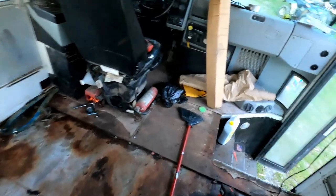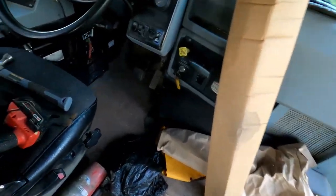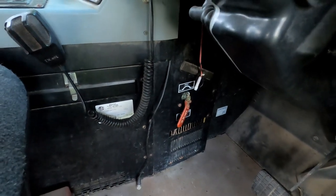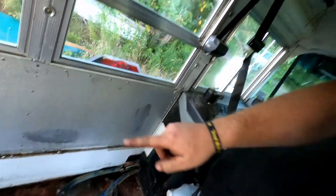But most buses come with this. Some are under the hood. We got one right here that shuts all the coolant from going back beyond that first heater anyways. But we went ahead and bypassed the line. I shouldn't say bypass, we looped the line so that just in case somebody hits that lever, it doesn't start gushing antifreeze out in the air after we get it all finished. That wouldn't be good.